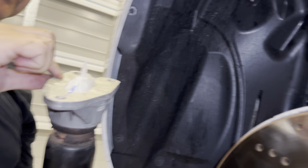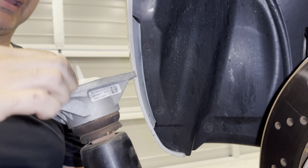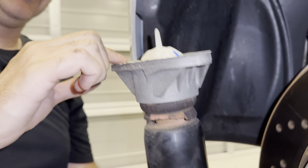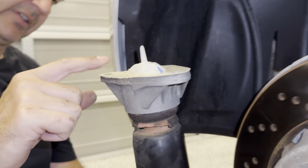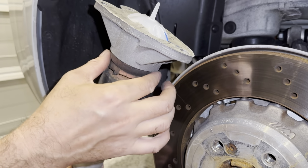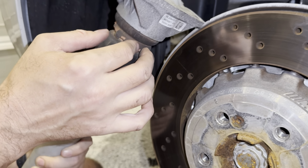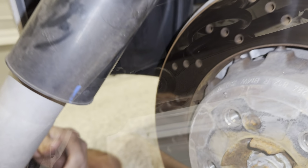Yeah, you got this little bit of, what is this? It's like paper. It is paper. Gasket. But I guess it keeps it from rubbing through to the paint. So we'll pop that plastic off and reuse this on the shock for the new coilovers. And just looking at this, such low kilometers in this car, and it still looks like that bump stop's just had a little bit of dry rot, which is odd. Okay, cool. Well, they'll go in the box of spares.